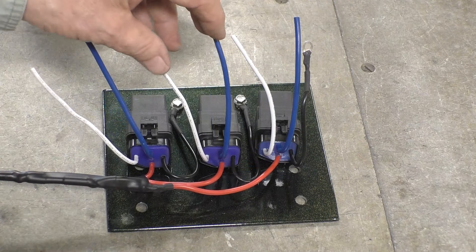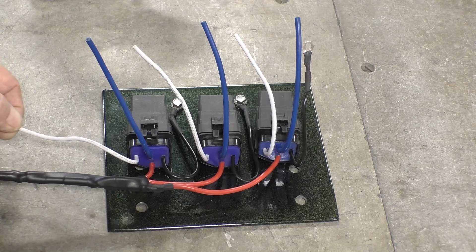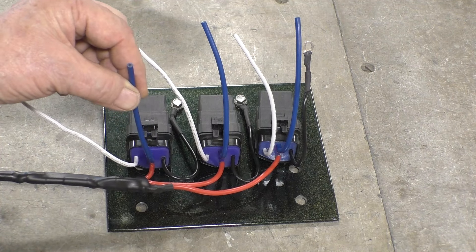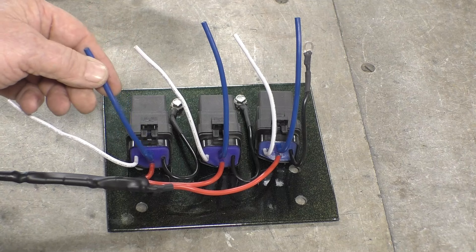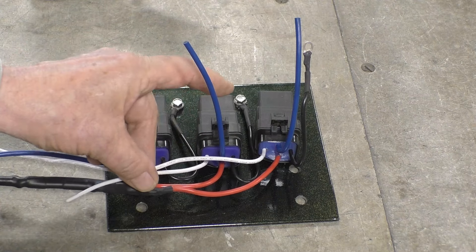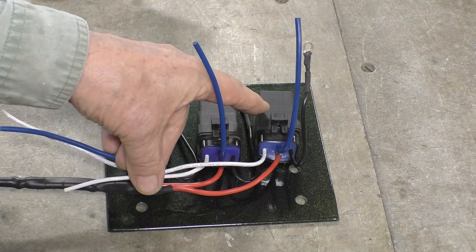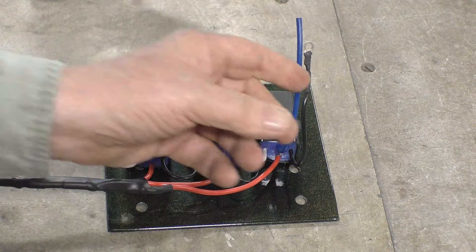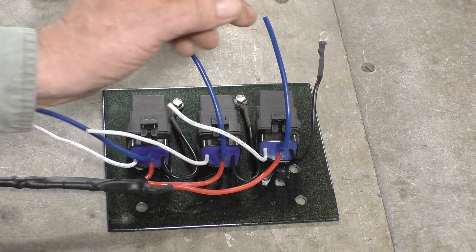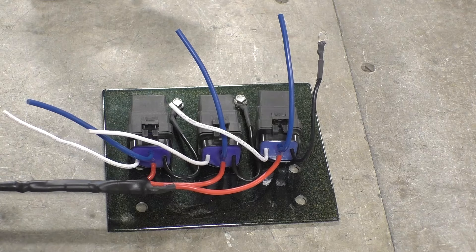We have two wires coming out of the first two relays and three wires coming out of the third relay. This is the signal — the low-current signal from the driver to turn the relay on, to send power to the water pump in this case. This is terminal 86; this is terminal 87. This signal is going to be tapped onto this signal, so whenever the driver turns the fan on in the car he is signaling both of these relays to come on and supply current to both fans. Except that this one — the ground is hooked to the temperature sensor in the block — and there won't be a ground for this relay until the block gets up to 185 degrees. So the auxiliary fan won't come on until the block is at 185.